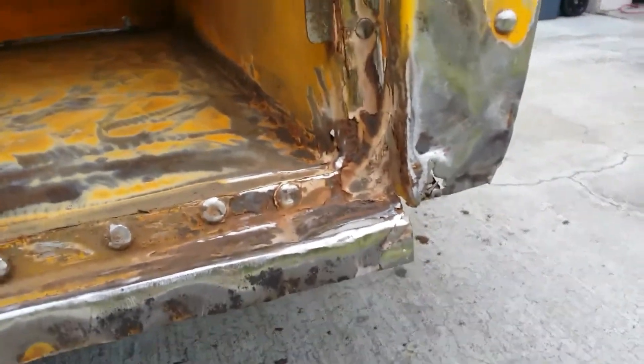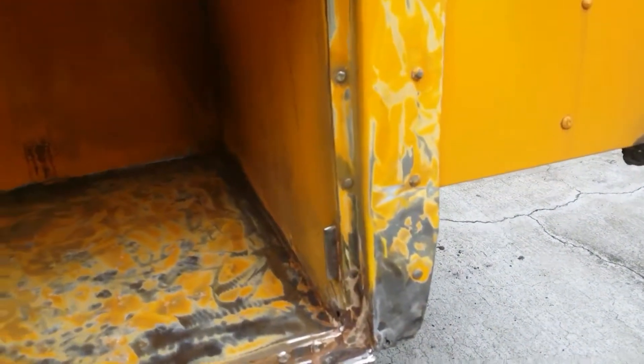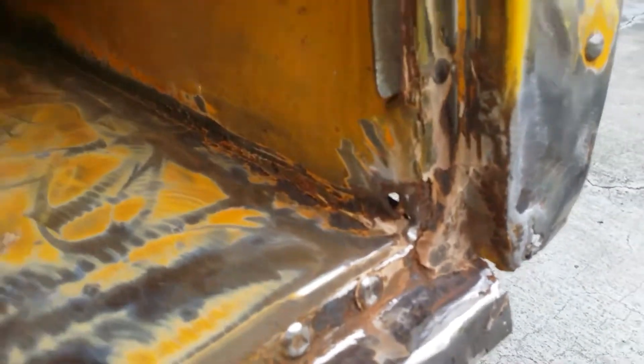Bus companies figure Bondo is the best way to hide something. It's all kind of crappy - Bondo actually holds a lot of moisture in it, and unfortunately in a corner area like that, that's really not what's needed. They don't want to invest money into re-metaling it. Just a little heads up - it looked fine but once you start grinding on it you see all the bubbling rust behind it. I've got to scrape all that out. I'm knocking it all down and then I'll re-seam it all through there.